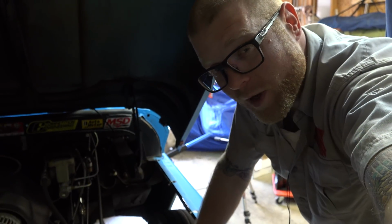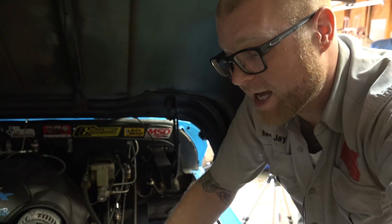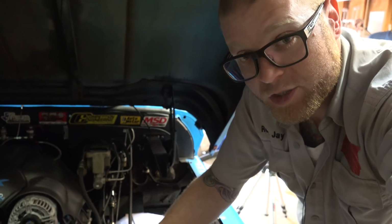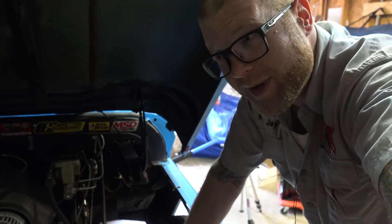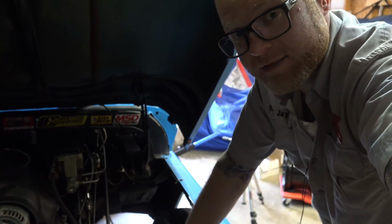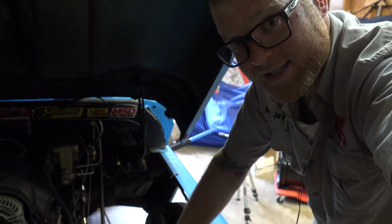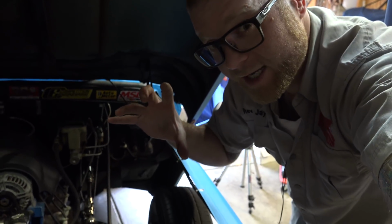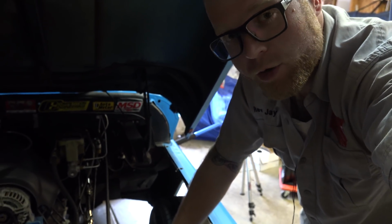Now when I originally got the truck, even before I did the engine swap or anything like that, it just had non-power front disc brakes with the rear drums. And the front stuff was switched over from a 71-72 C10. So it's got front disc brakes with the D52 style caliper, that's the GM full-size caliper, on a 5x5 lug pattern, and it has the 1.25" rotor.